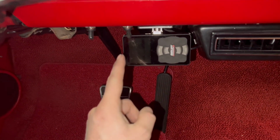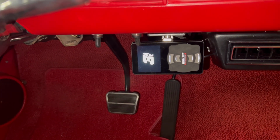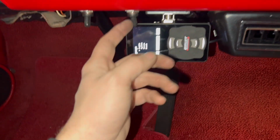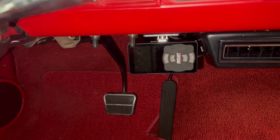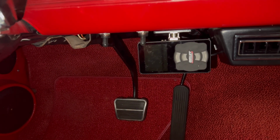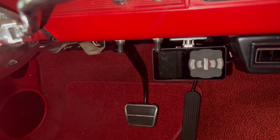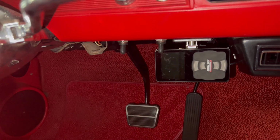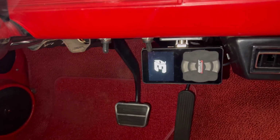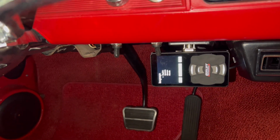I like to always have my Airlift controller and the compressor and everything on a switch so I can turn it off. That way there's not a super drain on the battery if your tank is empty. I don't want every single electrical thing to turn on at the same time when I start up my truck. So I'll start my vehicle, then I'll hit this down, and then my compressors will kick on and all the air ride stuff will happen.